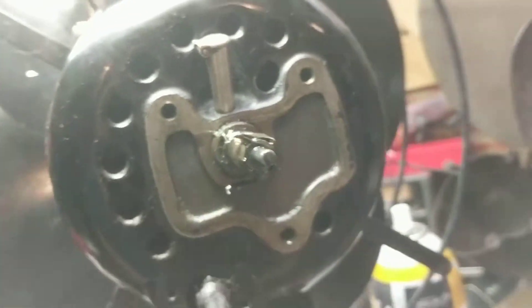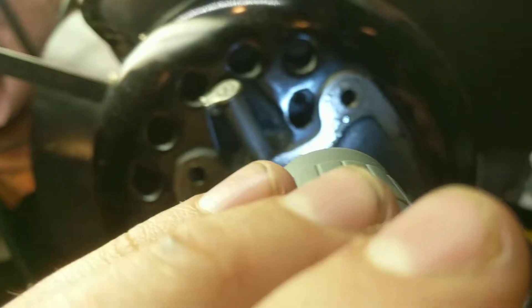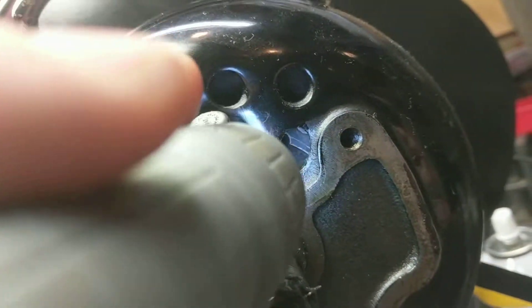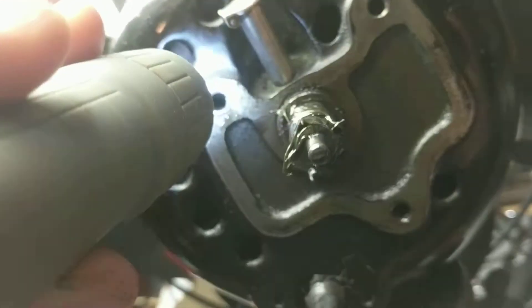If you don't balance them it can wear down and just ruin the fan. I have a flashlight here to show you — you stick a screwdriver or Allen wrench like this into a hole in the rotor. Make sure not to hit the windings — they're wrapped right there, you can see them. Stick it into that hole and it locks the rotor. Then you turn the blades — not the way they normally run, but the opposite way.